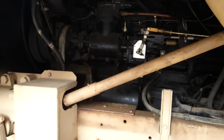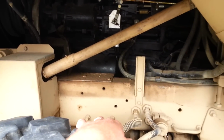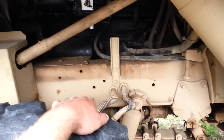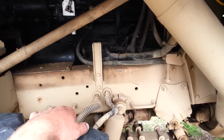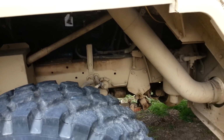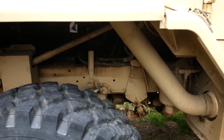I don't know. Maybe it could be an air compressor, I suppose. Maybe an air compressor bearing going. It doesn't look like it's coming out of the piston skirts. Yeah, I don't know what to tell you. I'm not sure what's going on in there. But it isn't a slap a head gasket and go kind of deal. So that other truck better hold together, because we're going to be stuck with it.